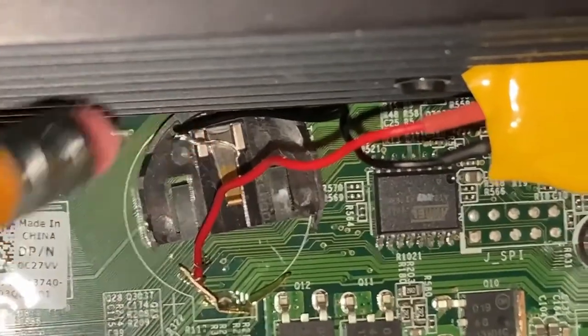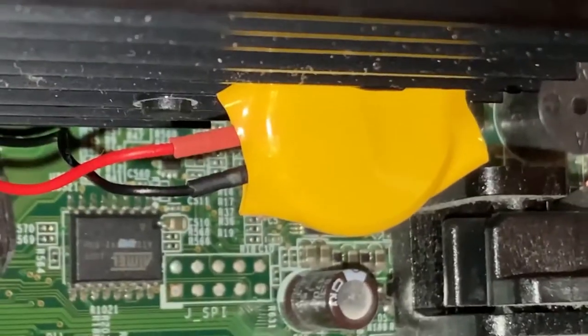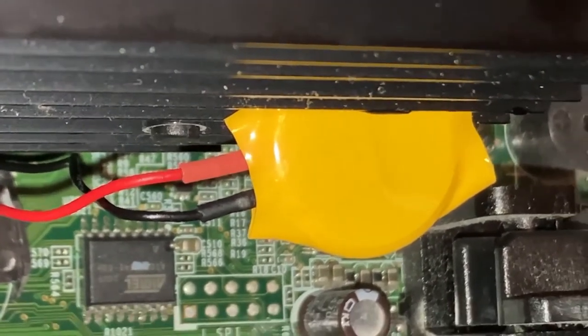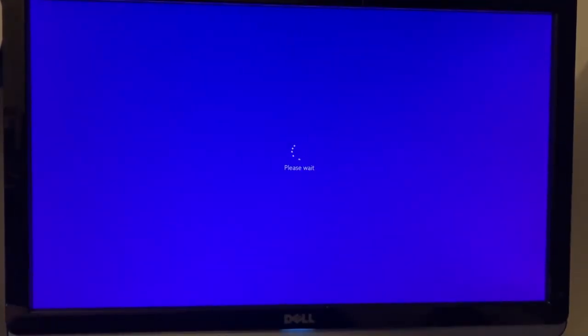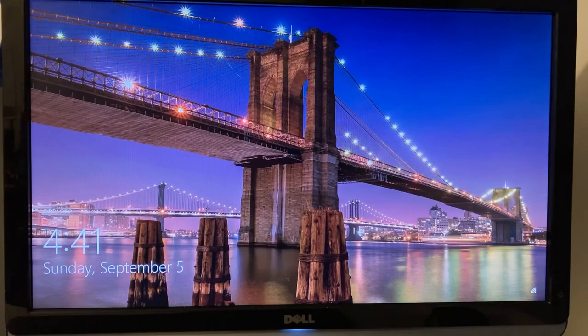With the glue on, I'm going to put it into one of these slots. Both wires are still connected to their terminals — the red one here, black one there — and the battery is in this little plastic holder, so it should hold and not come out of the slot. I'm waiting for it to ask me to set the date — if it accepted the battery, it should ask at least once so it can hold that date going forward. Looks like it got the date. I'm very happy with the results with the new battery — thanks for watching.